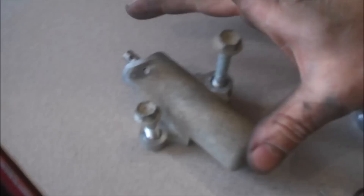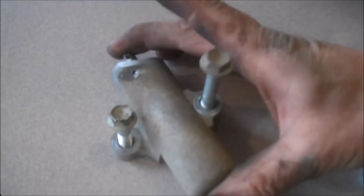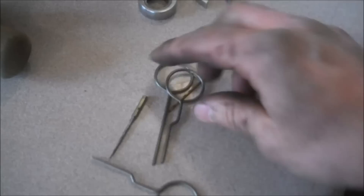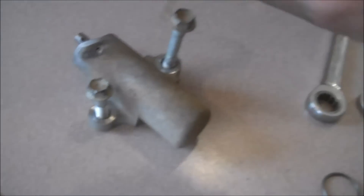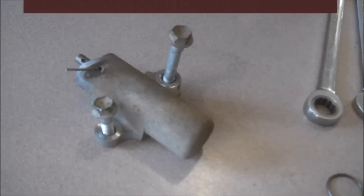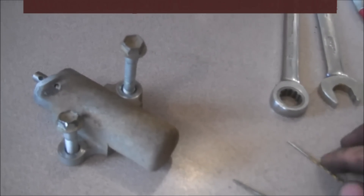We'll need to re-collapse this, put this in a vise or a C-clamp and slowly compress it down. I think I have a video on compressing these. Maybe we have a selection of keys from days of old, or a drill bit that will fit through the holes and hold it in place. Once your timing marks are lined up, you can pull this pin and let the tensioner do its job on the timing belt.